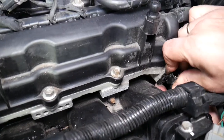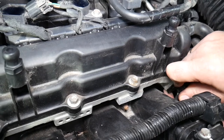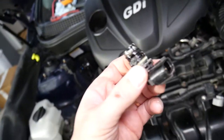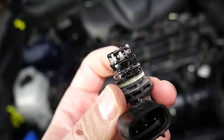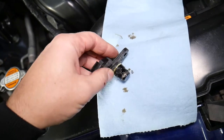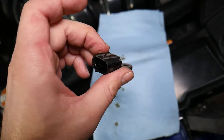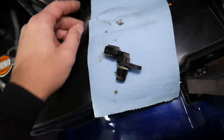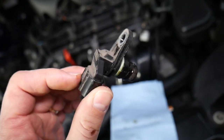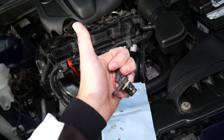The bolt came loose — don't drop it. You can disconnect that bracket and move it to the side for easier access. The sensor will be stuck — slowly apply a little bit of pressure, jiggle it a little bit; it has an O-ring that's stuck. Pull it out — this is the sensor. In some cases it could be a dirty sensor that doesn't detect the camshaft movement correctly. We'll have a special video explaining how to test those on a Hyundai coming soon. If you need to buy a new sensor for a good price, the link will be in the description. Thanks for watching and see you next time.